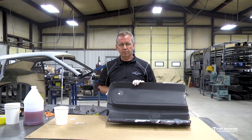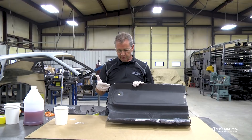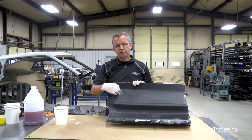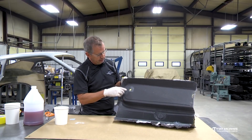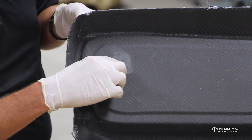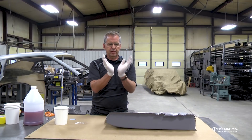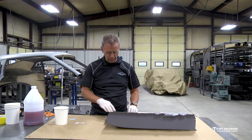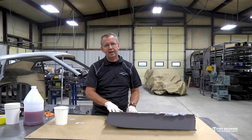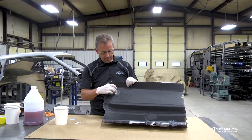Once that fastener has come loose, if the base is still in good shape you can drill out the rivet and just reuse it, or put a new one in — by that time it probably needs replacing anyway. So let's say we're putting a new one in, but this hole is now all chewed out or larger than it needs to be. In advance of this I went in and sanded the area on the back around where I'm going to do this repair, and I dug out the center of the eighth inch hole so I have some area to put fill material back into — because just putting a patch over this on the backside doesn't give you anything to bite back into. We need to fill this hole with some material and then cap it with a little small filler.